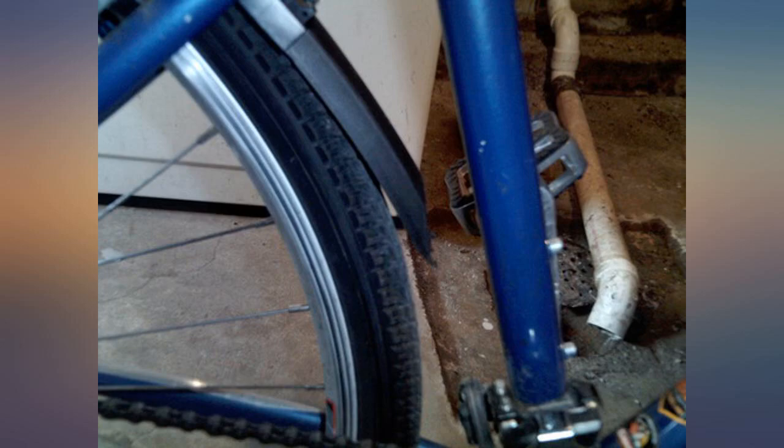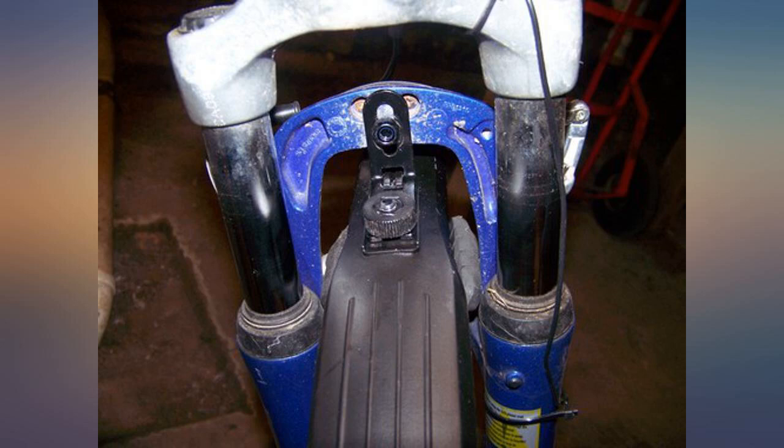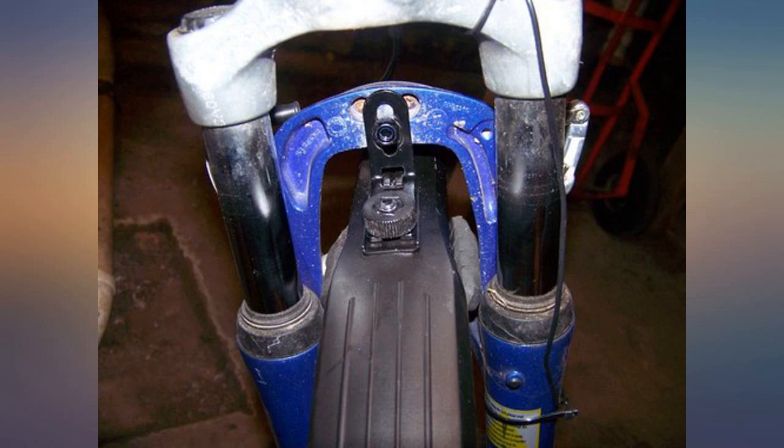I suspect that this may be a problem for some fitness road bikes, but not all. I only gave these fenders 3 stars because the rear fender mount did not appear to work with my bike frame, and the supplied screws were not compatible with the mounting holes on the fork of my bike. I had to purchase 5mm 0.8 metric screws from the local hardware store to mount the front fender mount to my bike.